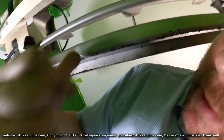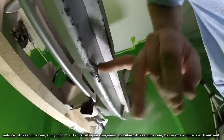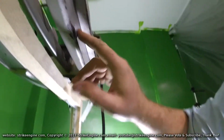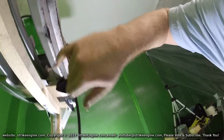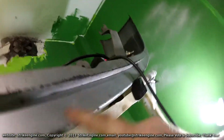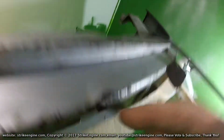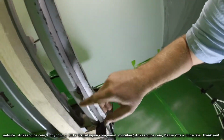This piece is at the bottom of the bumper here. So again, just heat this area up, push this in, push this side in, and push it from the inside down a little bit. So that's that heated. Again, it's not perfect, but I think it is better than what it was. So a lot less work to do with the filler. The bottom of it, again, this is not going to be seen, obviously, but I think we can put some filler in here and make it relatively smooth. There's always going to be a bump here, I think, on this edge, but not a lot I can do about that without going into major surgery.